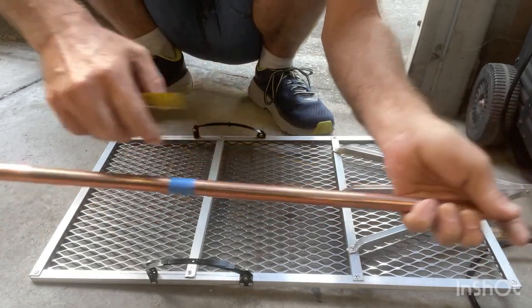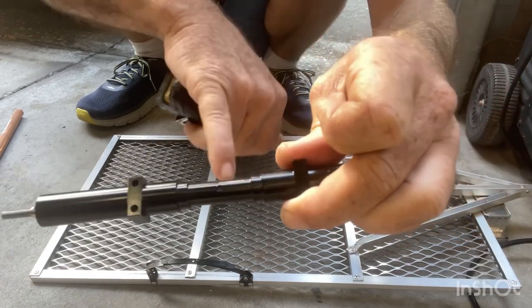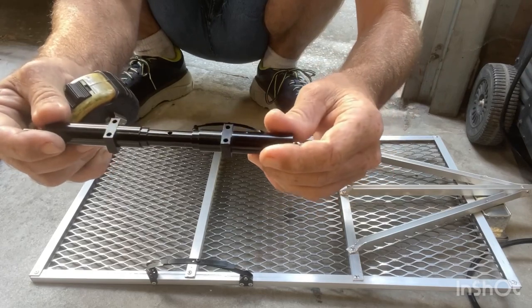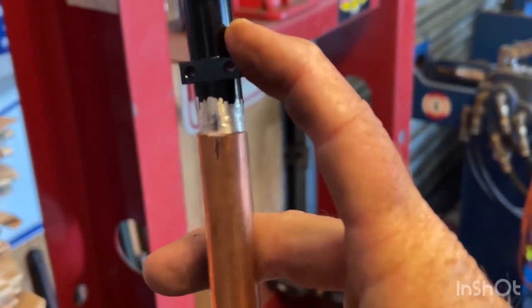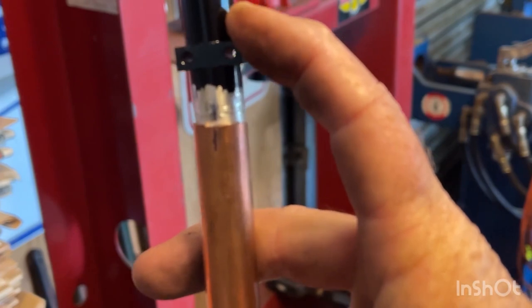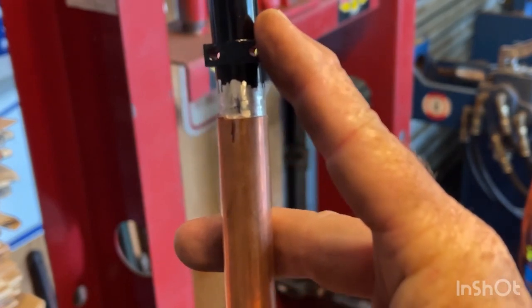Pull this thing out — 12 inches. Put that tape right there so you can make sure you're straight on your cut, and we're going to cut it right there. We're going to cut the axle right here at this center hole because we know that's the center. We're going to buff it down a little bit so it fits into the copper tubing. Let's get this stuff cut up. I can't emphasize enough — lay this thing on flat ground and mark it, because if it's crooked it's not going to attach right on the leaf spring. Get it readjusted, make sure it's straight, and let's get it pressed in.